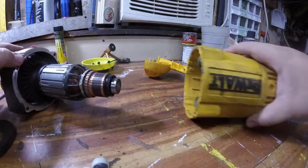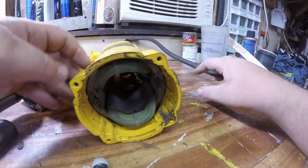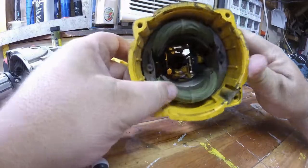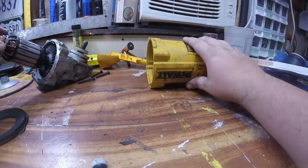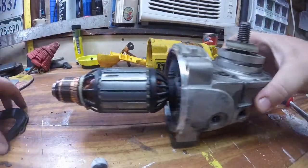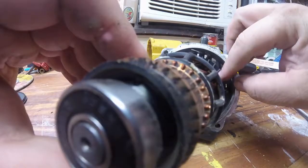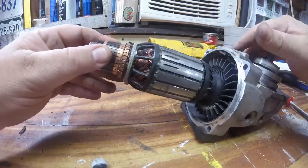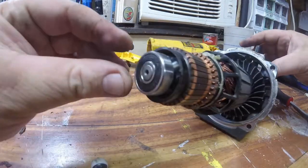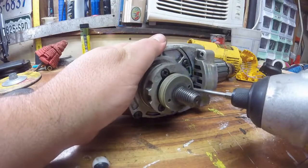Here I'm taking the motor assembly apart — the armature and the windings, looking inside the case. Pretty stout. Seems to be in good shape. Doesn't look burned or cracking. This tool would run fine — I just wanted to pull it apart and take a look at it. Interesting here is that the armature windings have some string coated in epoxy. I'm not sure if that's how that cage is held together, but it's kind of interesting. Pretty beefy bearings. There's bearings on each end — I think they're the same size diameter; I have a picture later with a measurement.